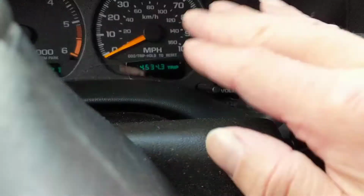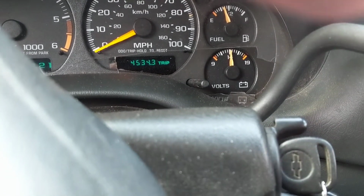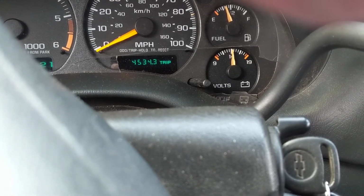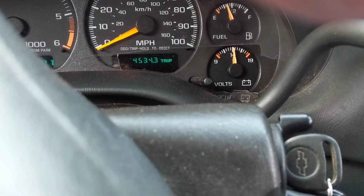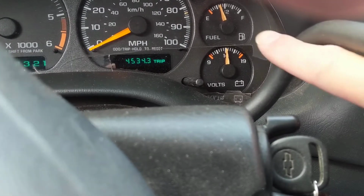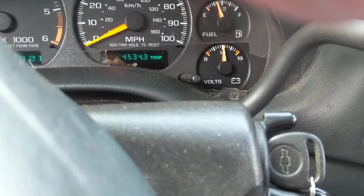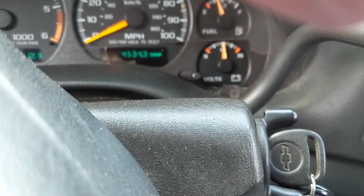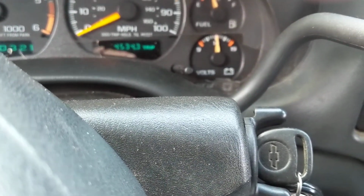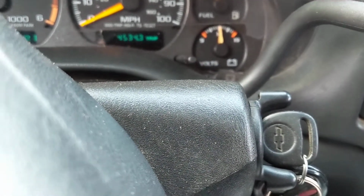If the lights go on and off on your instrument panel, and let's say it stays off, then you have a bad connection to it. Maybe the positive, maybe the negative to the engine block or the post. Again, also there could be corrosion, a voltage drop across the terminals like I made a video on. That's why you could be low voltage around 10.5, 11. You're losing voltage somewhere. If you're not losing it through the internal of the battery, you might be losing it on the cables themselves. And there are videos that I made about that, on the cables themselves, to measure corrosion or rust by an ohmmeter function on your multimeter.